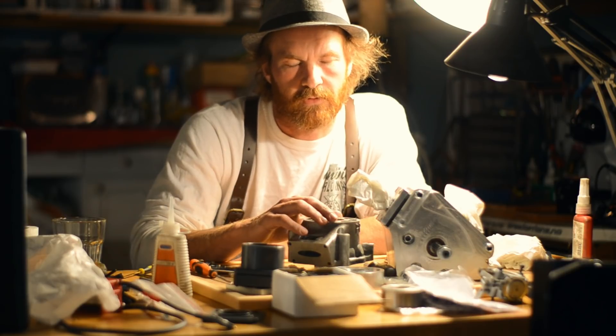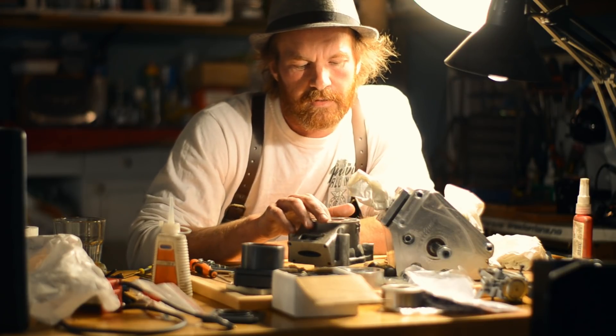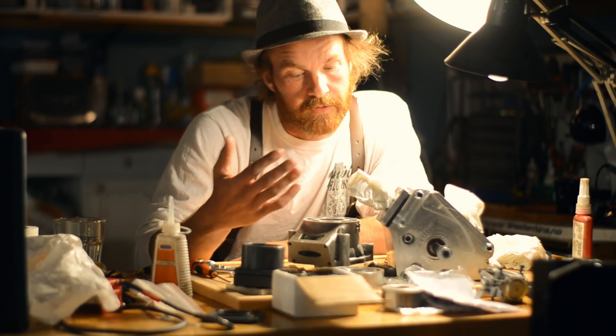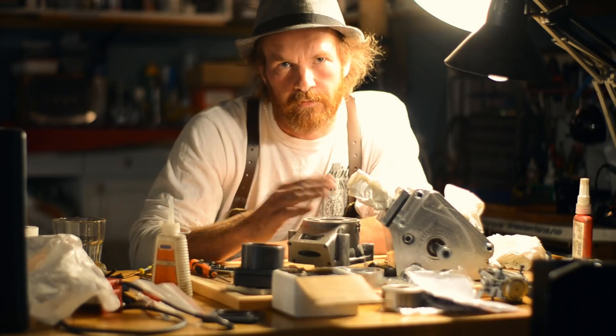So this is what I'm doing here. I made it as wide as possible, made it as high as possible without destroying the resonance. And I've removed the bridges — more area. I could put in bridges, but then we're back to just a normal run-of-the-mill modern racing two-stroke. And that's not what I want.